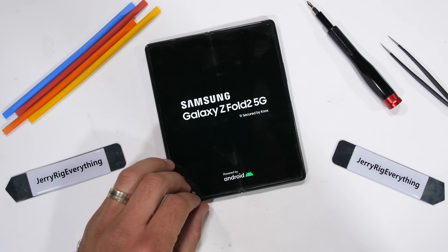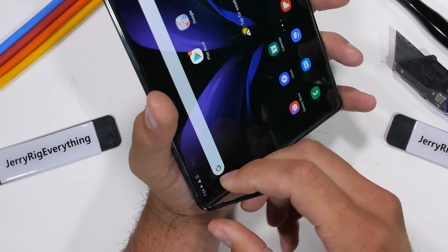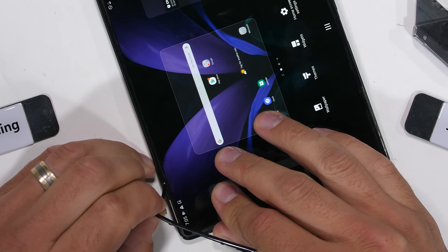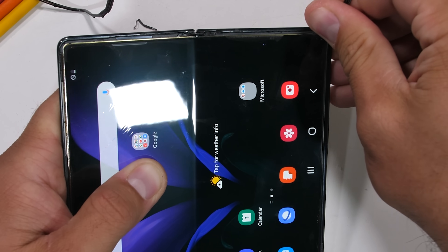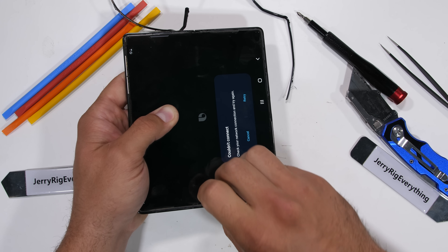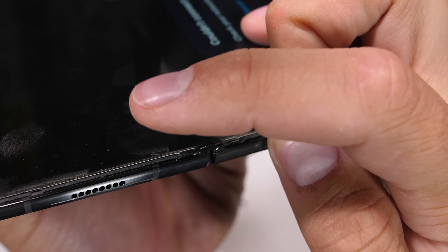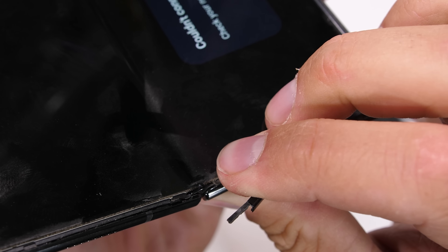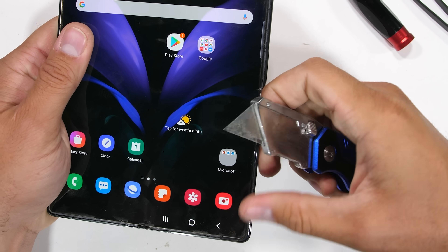Any responsible phone repair technician or manufacturer would advise against what we are about to do. But if we want to learn more about the limits of Samsung's flexible screen technology, we have to know at what point the screen will pass on from this mortal existence. We'll start by removing the plastic border around the interior display. This is a buffer to keep out dust, as well as keep the phone halves from clicking together when it's folding shut. It's got a bead of copper wire inside to help with the structure, as well as little clips and glue holding it to the foam frame — definitely stronger than last year's afterthought of a border. At the center crease there is a little buffer of foam that slips in the crack between the two halves. This might be what helped keep the dust out during the durability test. I hear there are new bristles inside the hinge, so we'll have to find those once we're done with the screen.